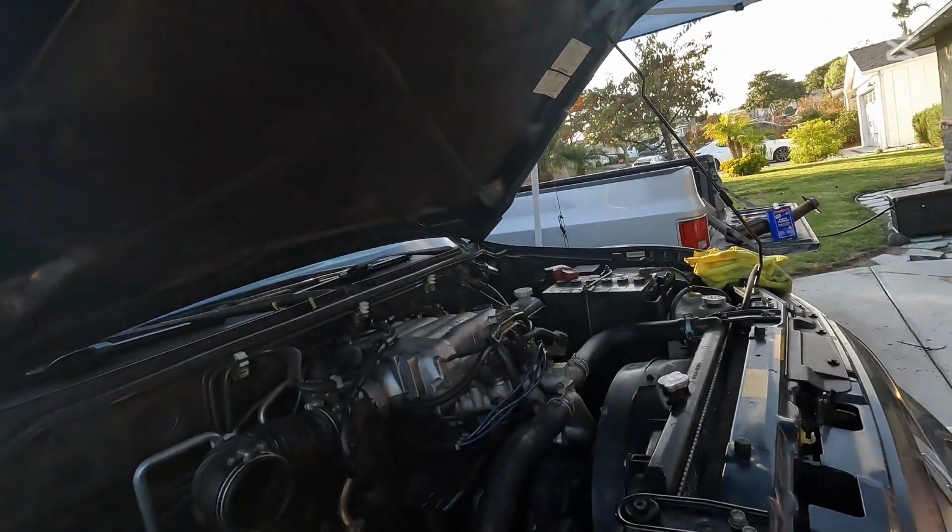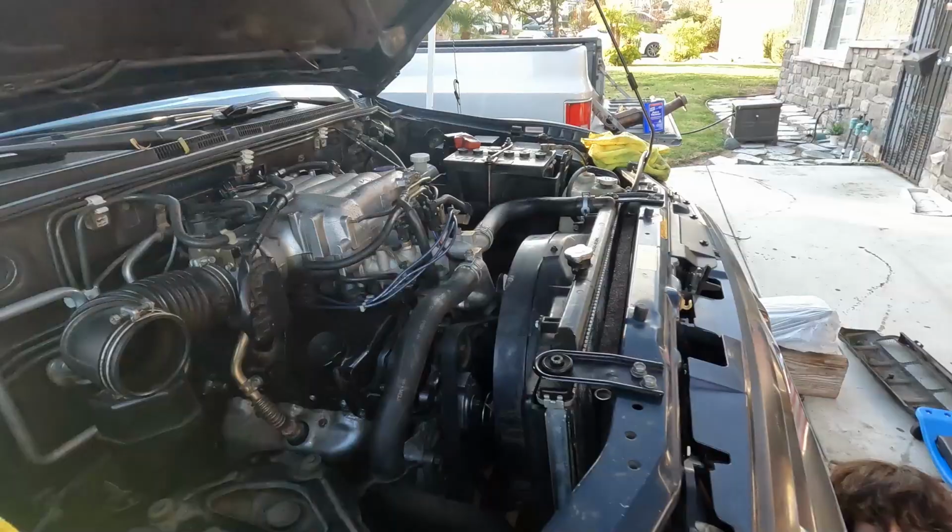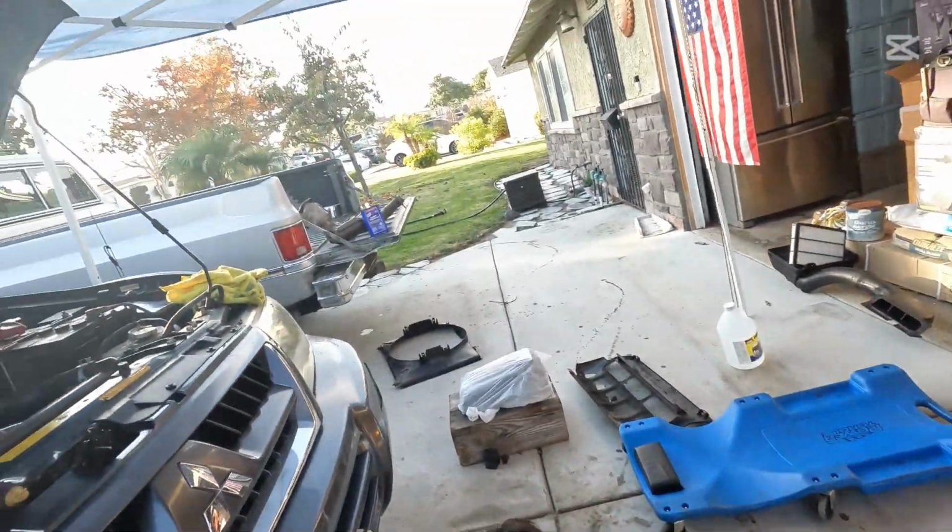So yeah guys, I really hope you like this video. Again, the important takeaways from this video is, when you buy a Montero and you want to take a look at the timing, or if you have a P0300, some drivability issues, and you suspect it's the timing, there's a way to check it on the Montero with that little window there. And also remove those 3 bolts and you can actually check the physical condition of the timing belt. So what we're going to do is add some coolant and some transmission fluid and take it for a little test drive, just to make sure everything is a-okay.